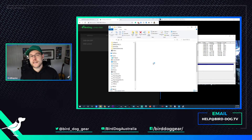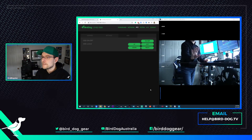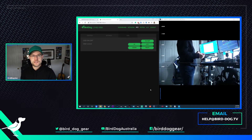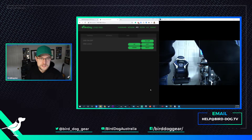Now I'm going to disconnect that thumb drive and close this all down. You can see my P200 is here. I'm going to take my thumb drive, disconnect my P200, plug in my USB stick, and power up my P200 again. Disconnected, plugged in USB, and now I'm repowering the camera. You can see that Studio Monitor has stopped because it's in the business of doing that. If you have an LED light on your USB stick — which is super helpful — you'll see it blink a few times on boot up. That means the USB port is actually reading that drive and is going to take that new HD20.bin file onto the camera.